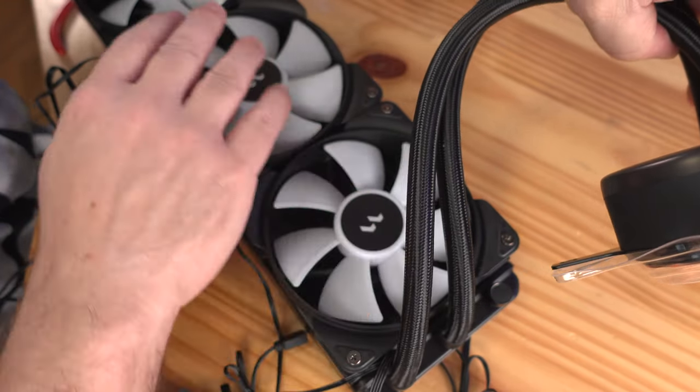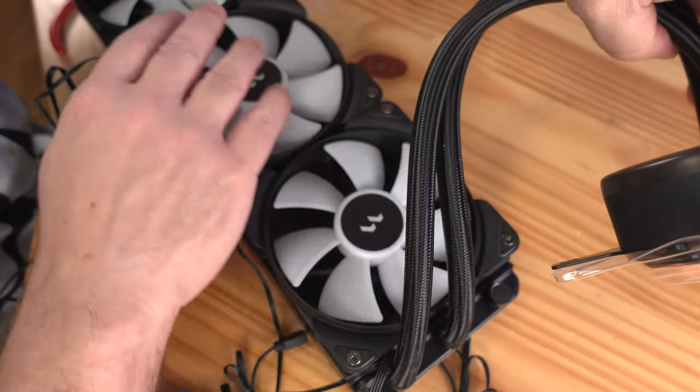While it could look nicer, I would say it looks pretty nice — especially with that vertically mounted video card. That right there looks nice, and coming around the back and the side it still looks beautiful. Coming around the back, I forgot to clip some of these zip ties — looks incredibly clean from the top. The fans and everything were already connected, which made cabling a little easier. I kept all the wiring through the metal pieces here, came down with the SATA power, then over here with the ATX, USB Type-C, and USB 3.0.